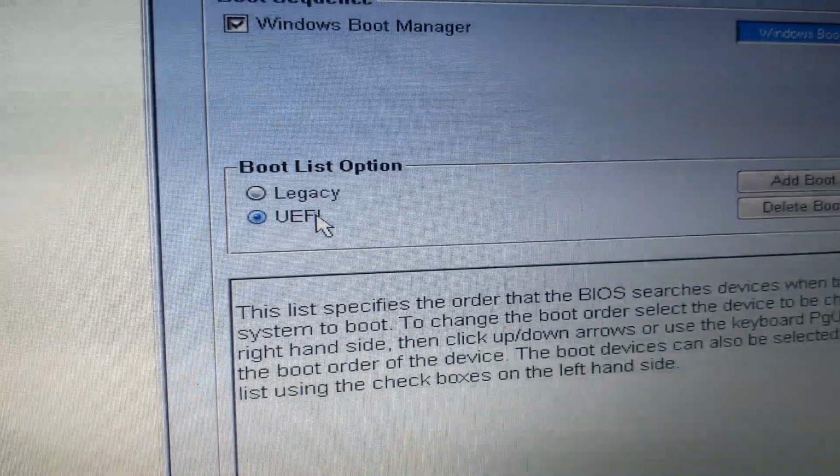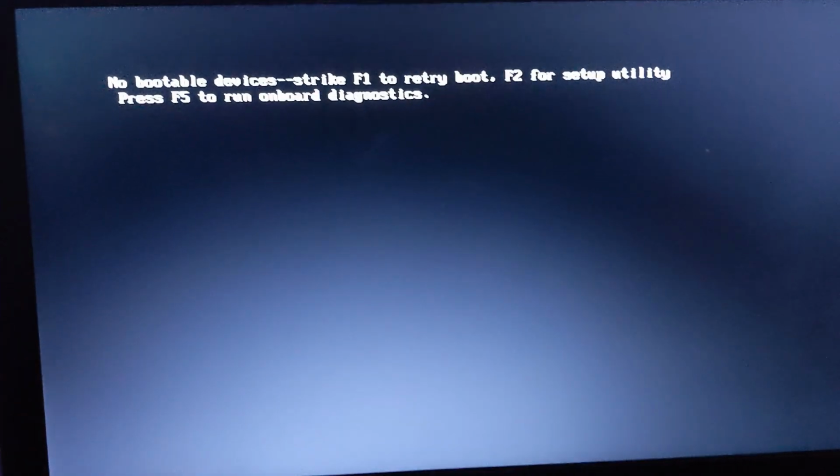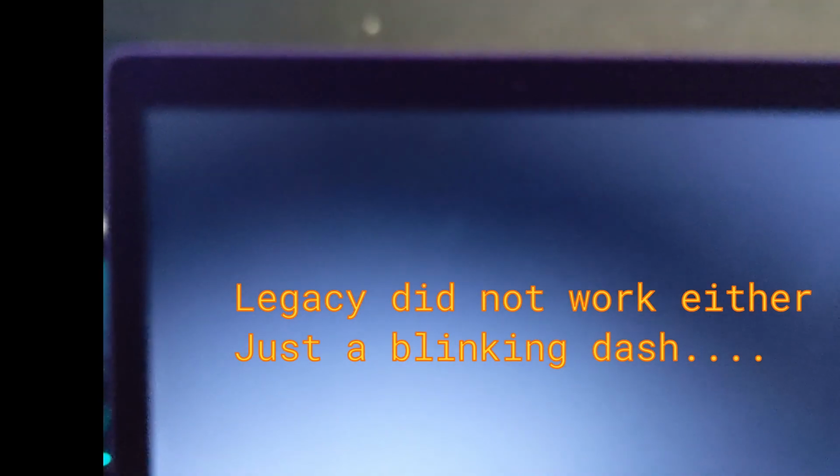Later, I did try booting the drive I did not want to install it to on that laptop, and it actually would not boot whatsoever. It said no bootable devices, and when I went to manually select it, it stayed on a black screen. I believe this was due to them including drivers in the ISO, which were not meant for the laptop.